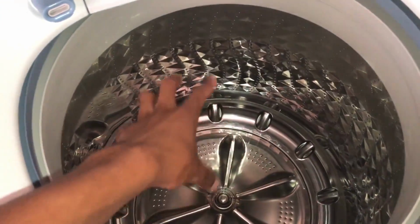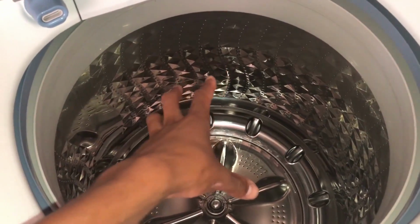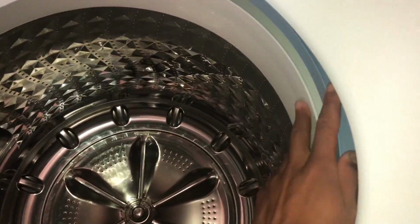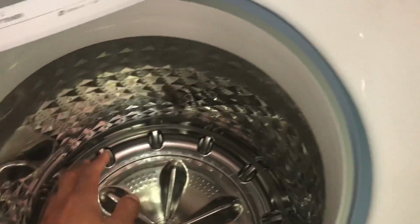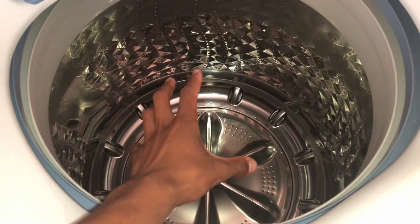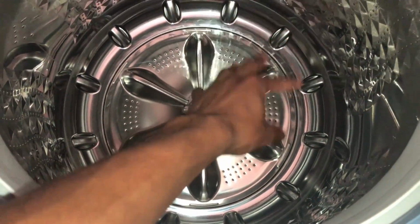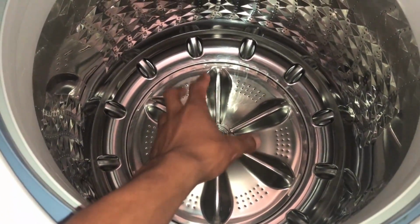And the resistance, it'll spin once or twice, or maybe 3 times. The resistance that's on that motor and the weight that's being pushed down on this is going to tell that one, the LG's, how much is on it. But on this one, it's not as sophisticated. It just moves the impeller around, which is part of the reason why it's not as accurate.